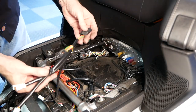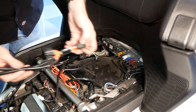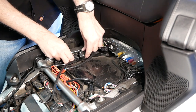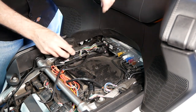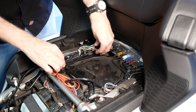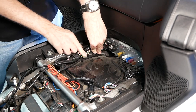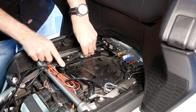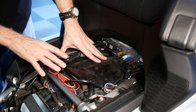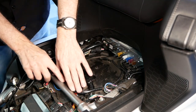Now we're going to unhook these connectors. This is our harness from the Pathfinder LEDs which I'm no longer going to use in my particular case. If all you have is Pathfinder accessories, this will be fine — you can use it. But in my case I've got my trailer, some other accessories, and some ShowChrome, so I'm not going to be using this. Now we're going to plug back into the bike's harness with the ShowChrome accessory isolator fuse block harness, and now we've got plenty of room under our seat.